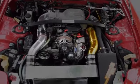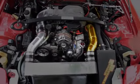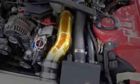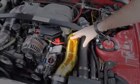Was able to take out some of the emissions-related airflow pieces and components that direct air to your catalytic converter. Everything else past the twin turbos, it does have the stock twin sequential turbos, is aftermarket in terms of the intake track. So that's one of the sequential turbos. The other one is kind of back under this pipe. One turbo gets fed by this pipe, the other by the one right underneath that. So then they both get collected after getting the boost and come out this pipe through the intercooler.